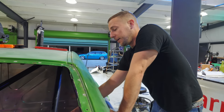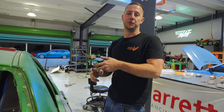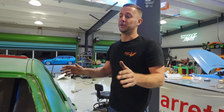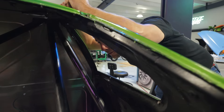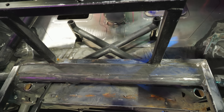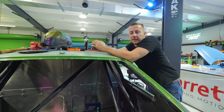It's also nice because we designed everything so we can take five nuts and bolts out of the quarter window and get to our battery, change the fire suppression tank, and have access to our fuel filter which is going to be over on the other side. Originally when this car was built the battery was actually where the stock gas tank is — directly underneath the car. So every time we needed a jump start or a terminal came loose we had to change the battery and it was a whole mission. We learned our lesson — everything is now in a serviceable location.